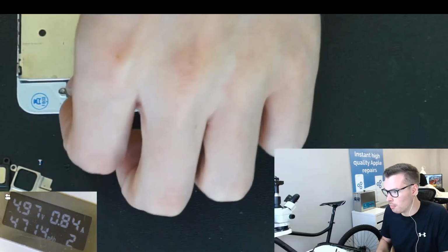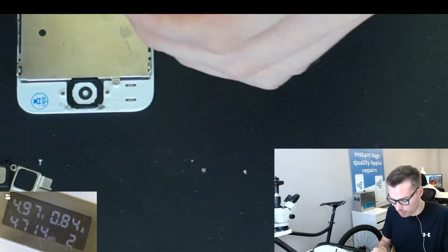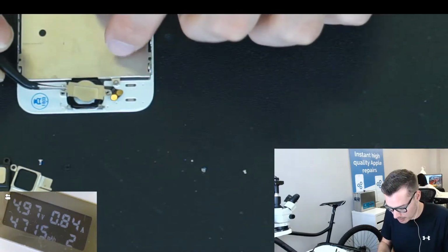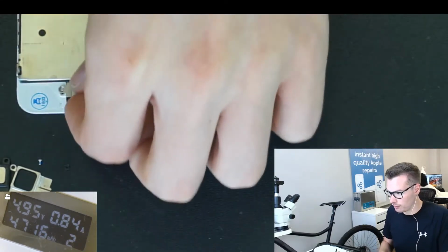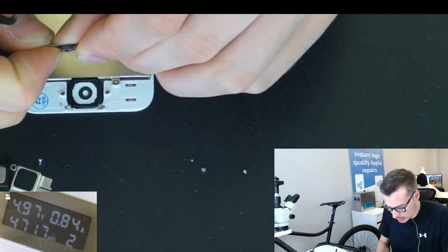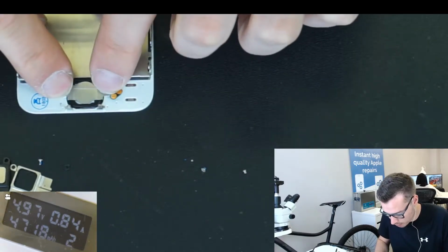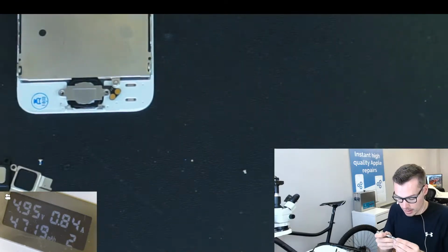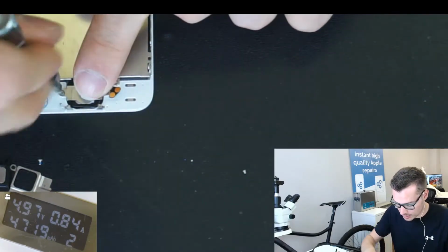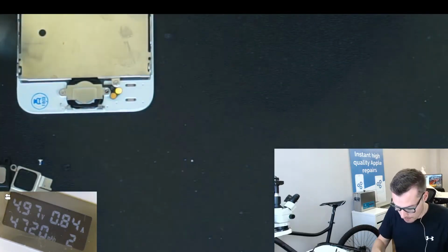This is sort of like home button calibration, really, and you can do this on anything, on iPads in general anyway. iPad minis tend to have a lot of home button issues because the assembly that Apple uses is quite flimsy. And instead of screws, it uses tape, because the iPad mini doesn't have a plastic frame, it's just adhered to the glass directly, the home button bracket. So on this it's a bit easier.